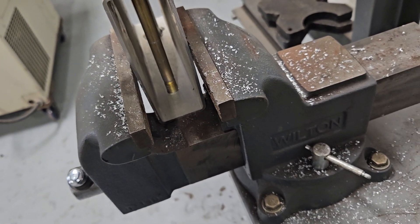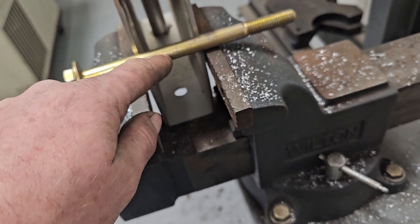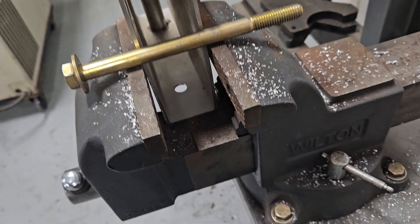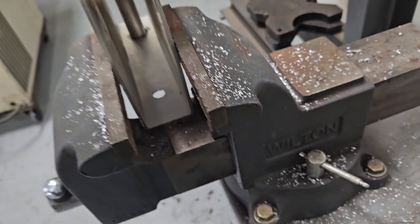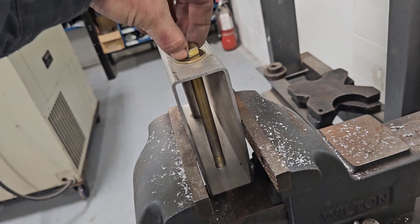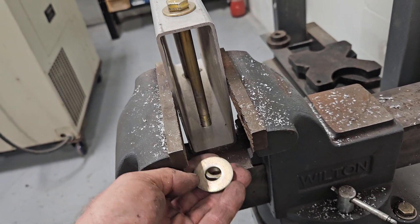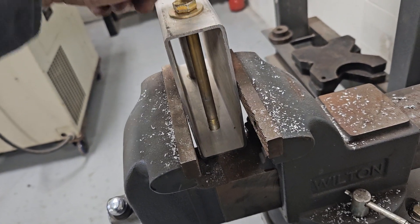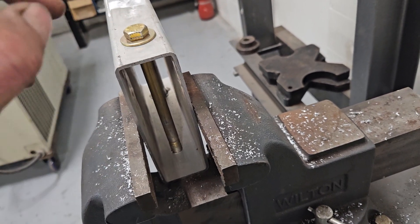...it's really not pushing against anything. This is a grade eight half-inch bolt. The torque spec per the manufacturer is 107 foot-pounds. A lot of trailer manufacturers — I'm fixing these things all the time here in the shop. They're literally cracking and tearing through the bottom hole, because if you've got a coupler bolted on from the top, the tongue weight and bouncing is trying to pull the washer and bolt through. Even with a plate under there, it's trying to compress and squeeze this, and eventually you're going to have a failure.